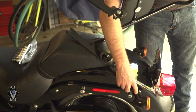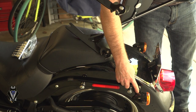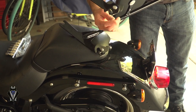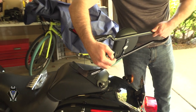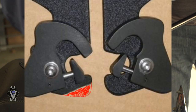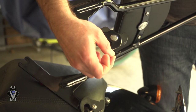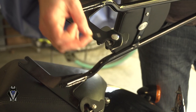The whole reason you need the relocation kit is that the normal turn signal mounting is pretty wide — it looks stylish. The relocation kit basically turns it into a small post to remove space. But if you look at the sissy bar, it has these little extra pieces on it which I used a Dremel to cut off. All you have to do is remove those little pieces and the sissy bar goes right on without any need for a relocation kit. Why Harley doesn't just redesign their sissy bar no one can say — it's probably because that relocation kit is so difficult to put on, you're probably gonna take it to the shop.